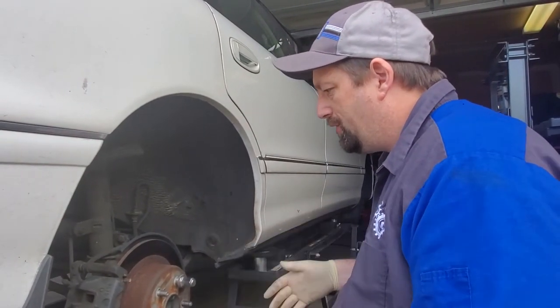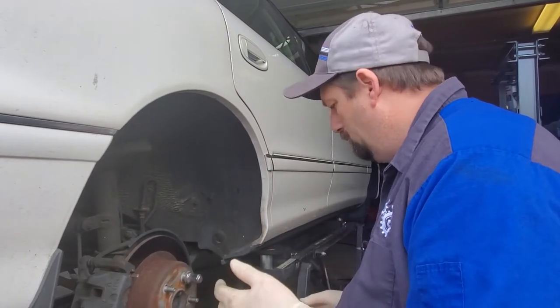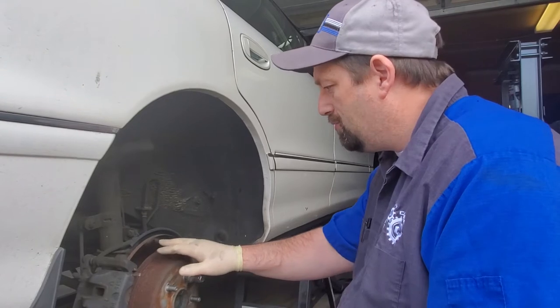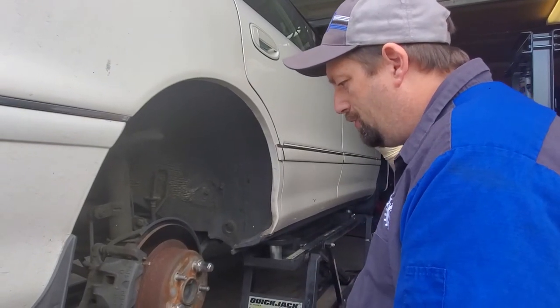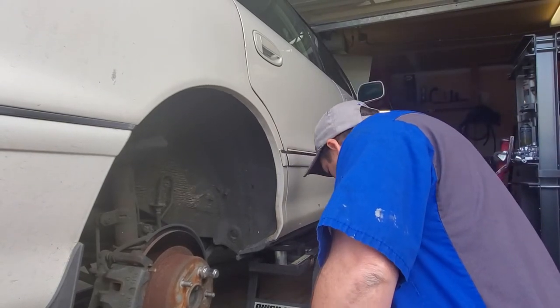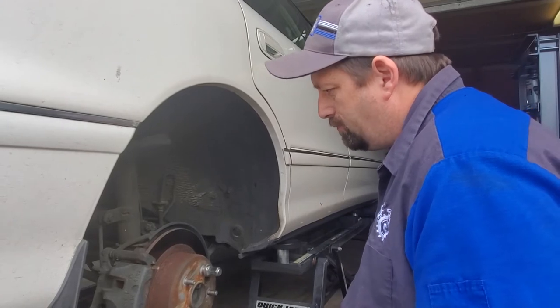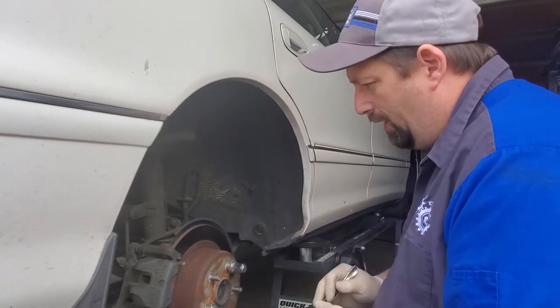On this one I felt it in my seat — I felt the car move but I didn't feel the steering wheel move. So I'm going to check for runout on these rotors. The customer has already given us the okay to replace the front, but I want to verify what the problem is, and the way to do that is with a dial indicator.